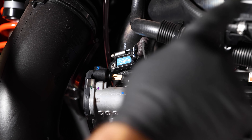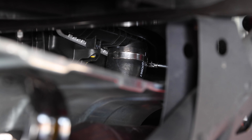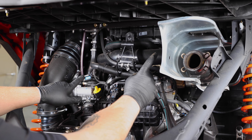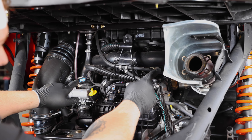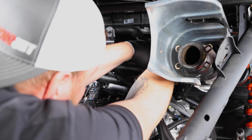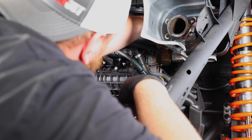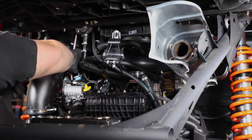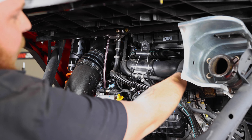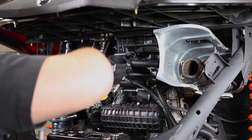Once you have that loose, we're going to go ahead and take off the tube side that comes down from the intercooler. Now we have both clamps on both sides of the tube off — we can go ahead and remove the tube. Pull down on the intercooler side. The clamp might come off as you're finessing it off. Take off the throttle body side and finesse it off until it's completely removed.